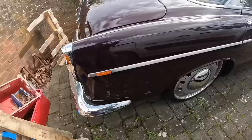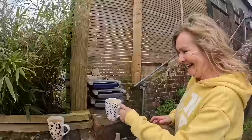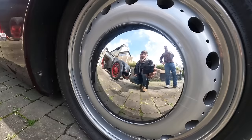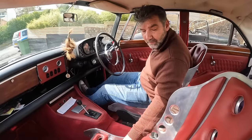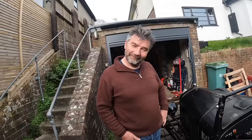We've got one more to do, and that's right behind him. Back in 2015, I wanted a British car on air ride with a bomber interior — I'd had one of these before when I was 18. So I thought, let's go for a coupe. This one came up, the Bangor Racer boys wanted it, but the bloke held out for someone that actually wanted to restore it. And that was me. The wheels are a Dunlop replica of a D-type — billet aluminium, three-piece, bolted from the inside — what they call classic build, so you don't see any of the bolts. The seats are from eBay, made by a guy from Poland. He made all the aluminium panels for it. Not only the front seats, but the back seats are bombers too. It's had about a four-year restoration. Thanks a lot, Warren, thanks for showing me around.